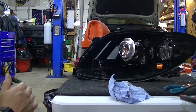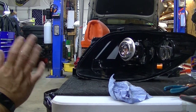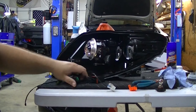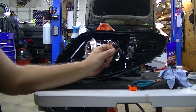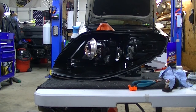I'm still waiting for parts. I already pulled the bumper to get the headlights out, so I'll film reassembly in reverse so that anybody who needs to change bulbs can see how to remove the bumper and get to the headlights. The parking lights in these are LED from the factory, and the turn signal bulb in here is a dedicated circuit.